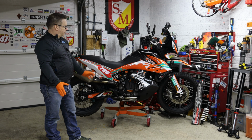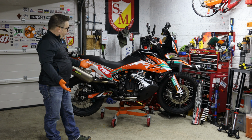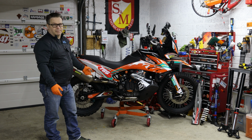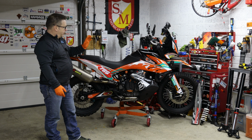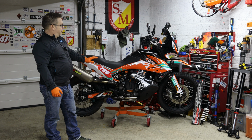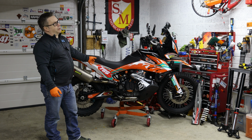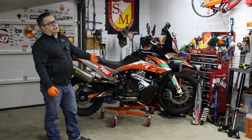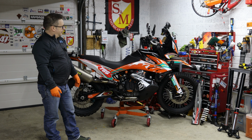That's it briefly for what I've done to the suspension on the bike. There's not really much to it. It's bolted on. It's a single pivot rear end, there's no complicated linkage. It bolts straight in. The tuners can set up your shock to your weight. If you're taking a load, when you think about it, these bikes are probably taking circa 220 plus 80 plus 20, so about 320 kilograms through the forks on sprung weight.